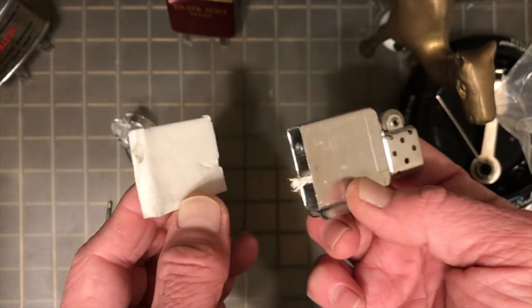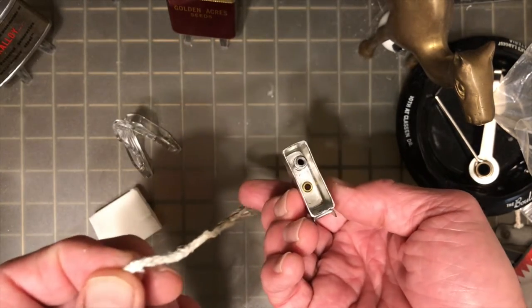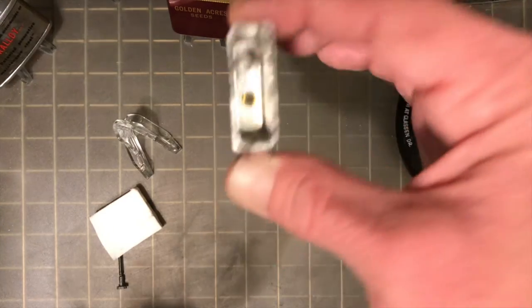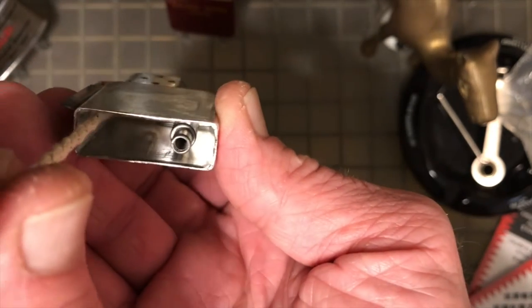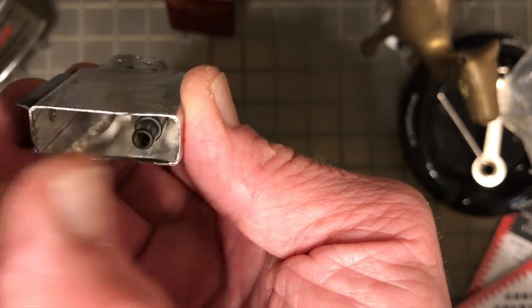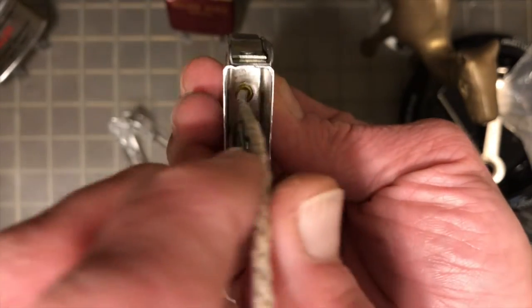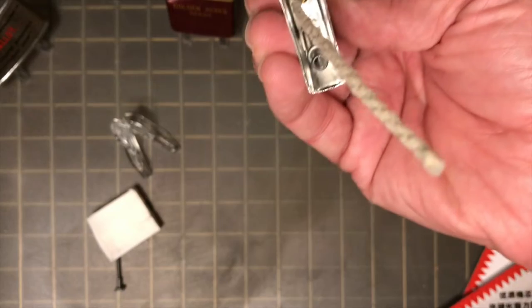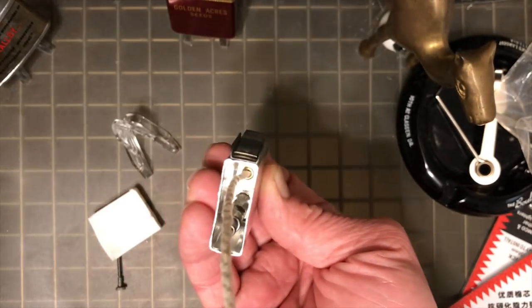You can see that sorry-looking wick that was down in there — not much to it. They really didn't come with much of a wick from the factory, and this one's dirty on top of that. Now that we have the insert cleaned out and ready for the new wick, we'll go ahead and slide that wick right down the chimney. I've been told in the comments that I'm doing it wrong by sliding it in from the bottom, but for me that's just always been easier if the wick fits.